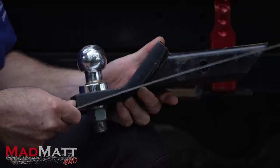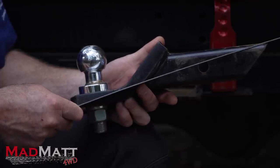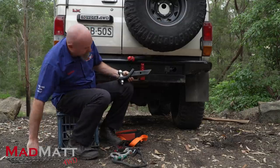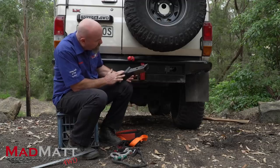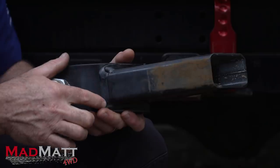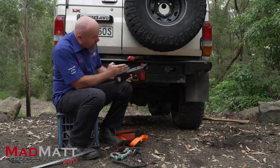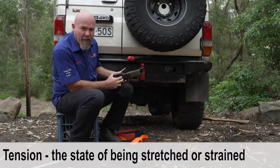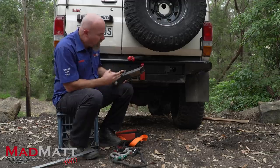So it's not a straight line pull — the energy has to travel. Energy is always going to travel in a straight line, so that's roughly how the energy is going to travel, as the ruler is showing us. Now I want to highlight this point just here. All of this energy from a recovery is coming through and it's got to transfer from this plate into that tube. And there's something called a stress riser created through the root of this weld here, because that is in the centre line of the energy transfer.